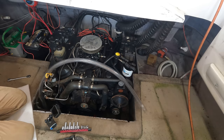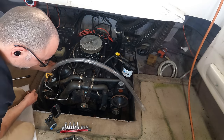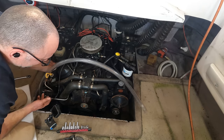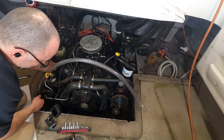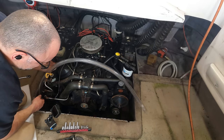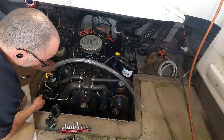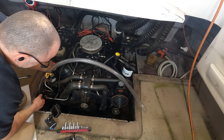You know, we might actually save this thing from the scrapyard, which is pretty darn rewarding. I feel I should mention, I wasn't actually done. I mean, I had kind of given up on hope, but I was going to keep trying some things. And if my custom crankshaft pulling wrench had not worked, I was thinking about trying to get the ATF out of the cylinders and then filling them with Evapo-Rust and just get that rust off of there chemically and then try again. If that didn't work, I think I was done. But yeah, I mean, don't give up.